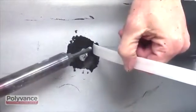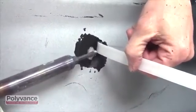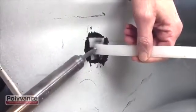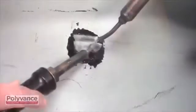Using a wide polypropylene ribbon and a nitrogen welder, weld a pass of plastic starting at the edge of the hole to lock down the welding rod onto the bumper. Overlap the ribbon over the previously laid ribbon until the hole is covered. You'll weld the other side in the same way.